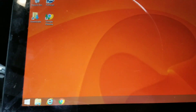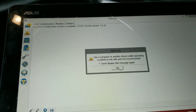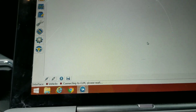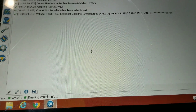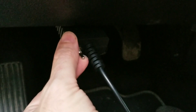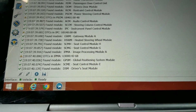We're going to go into FORScan up here. Down here on the very bottom left we're going to click on Connect. Make sure it's on H — and it is. Let it connect. It found our truck, so we're going to click Yes. It asks if your vehicle has the module — we're going to select Yes, switch this up, and then hit OK. Looks like we're ready — it says Ready.